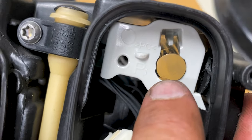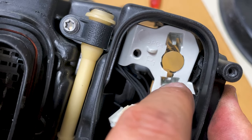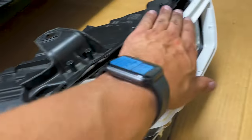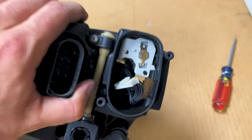What you need to do is take a little razor and cut off all the burnt ends on it, then take a dremel to smooth it, and then use some acrylic polish to polish it up. It did end up being a little bit shorter, but now I pretty much have full brightness on the DRL of the headlight. So really if you have this issue with just your DRL being dim because of the burnt end, all you need to do is take some time to clean up the end of this tube. Double check to make sure the LEDs are working, then polish it up and it'll be good to go. That's how I ended up resolving it.